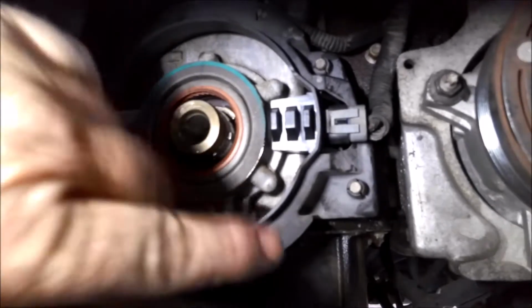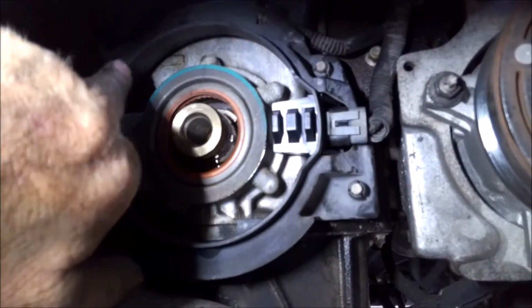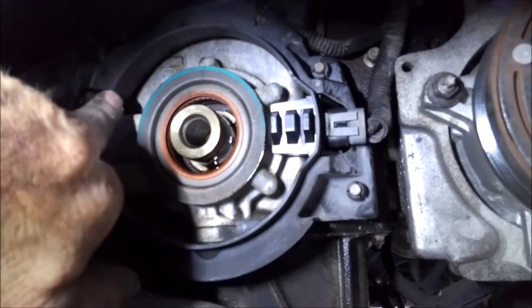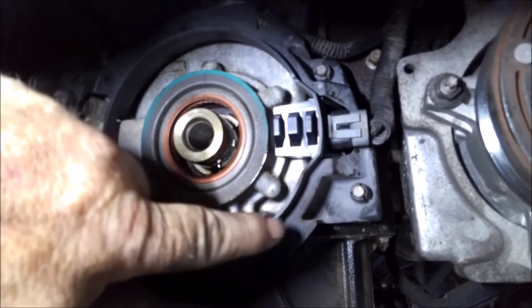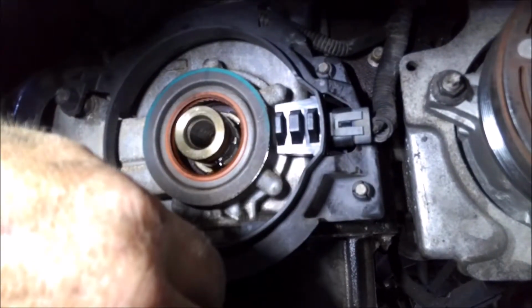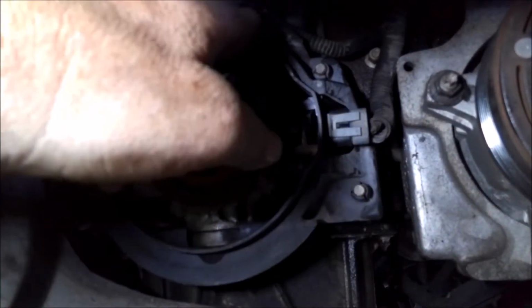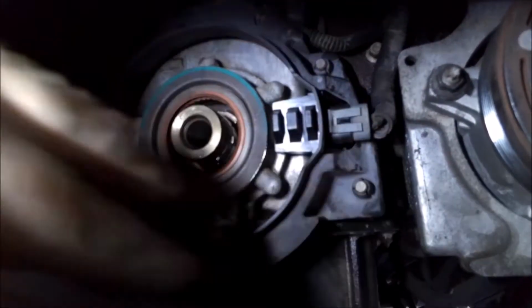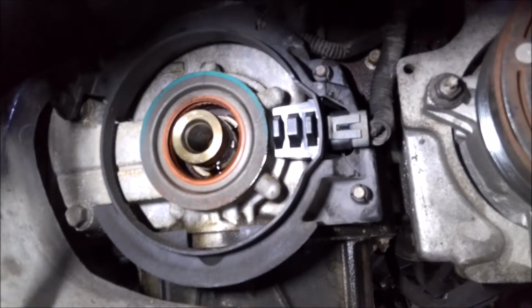And remember, before you plug your sensor in, put this dust shield back on. There's just 3 points that it pushes onto. There's 3 studs. You got your 2 studs for your sensor, and there's one over here. It just presses on, snaps in there, and then plug in your harness. And then there's a spot on this shield here that the harness clips to. Clip that back in, and now you're ready to put your harmonic balancer back on and start running that back down.